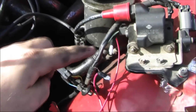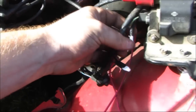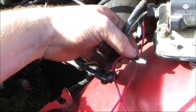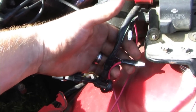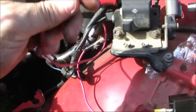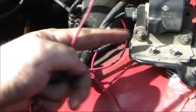I've got this wire going to the end that goes to the clip itself. I'm just using dolphin clips — I work in the alarm industry and these are what we use to do connections, but you should use soldered connections for best results. I'm just using what I have on hand and wrapping it with electrical tape. This one right here is what you're going to put where it says pin 30 — it's going to be the one that goes to this clip here, that's where the power goes out to.